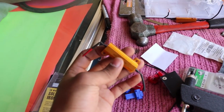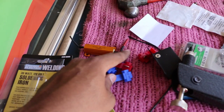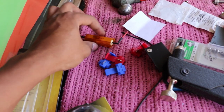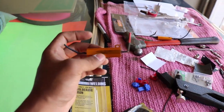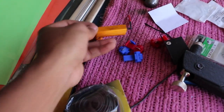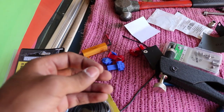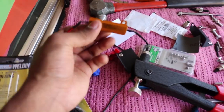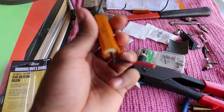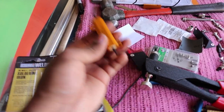The reason you want to mount this resistor to a metal surface is because it creates a lot of heat. It creates a short — you have a negative ground on one side and a positive terminal on the other side, and when you touch a negative to a positive everything gets really hot, like plugging jumper cables in the wrong way. If you mount it on plastic it will melt, on carpet it will burn. So take that as precaution — put it on a metal surface so you don't run into any issues.